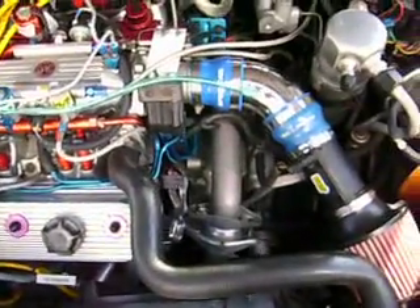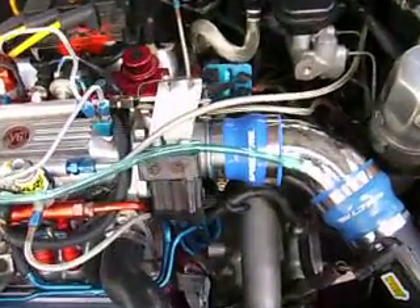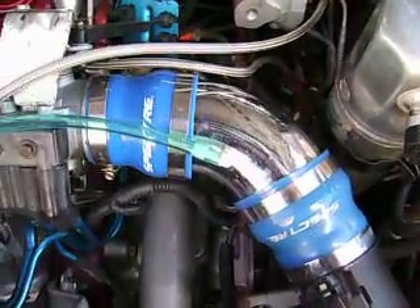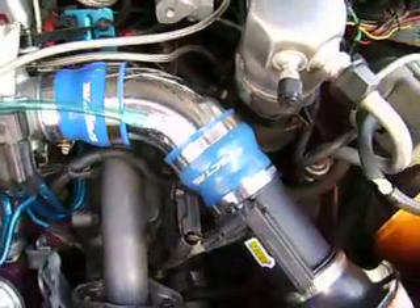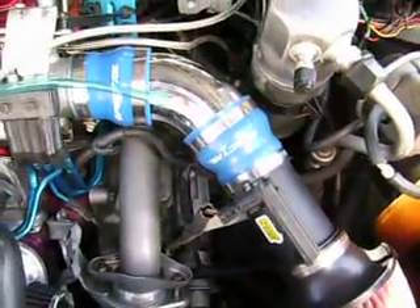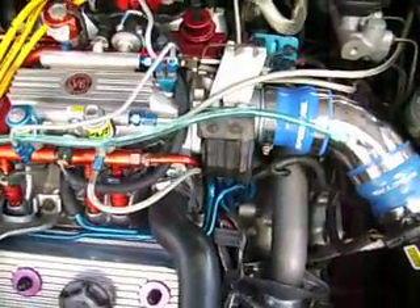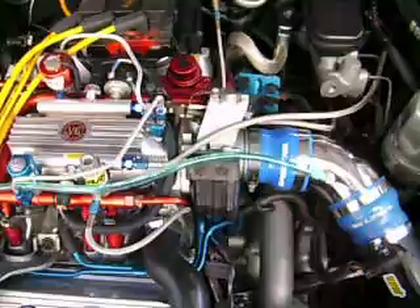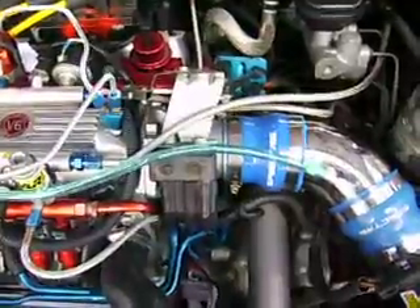Of course the usual Smackamization — everything's painted and done up nice. The first thing I want to show you is the connection from the outlet of the booster into the intake manifold, as close to the throttle body as reasonably possible. Mine is downstream of the mass airflow sensor simply because I want to get as close to the throttle body as possible, minimizing the amount of stagnant or unburnt hydroxy fuel within the intake system.